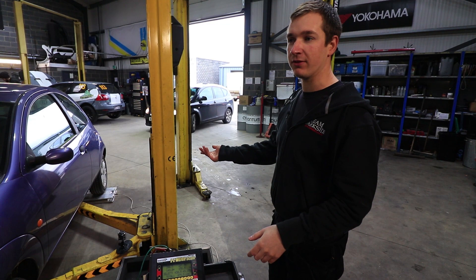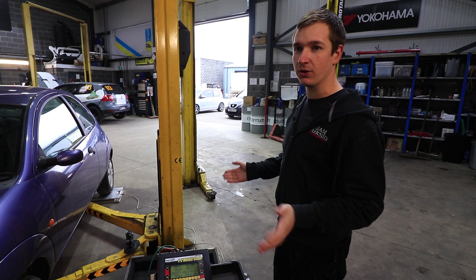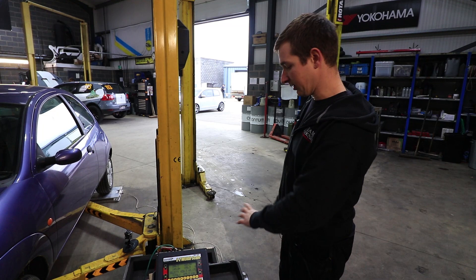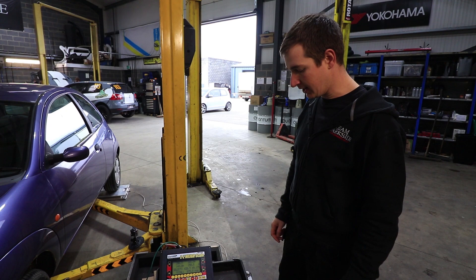That means I'm about 80 kg and Scott's about 80 kg. If we get a really light driver we're going to have to ballast up; if we get a really heavy driver we could do with being lighter. We've got some ballast plates from our other cars that we can just throw in if we need to, and they'll go on the passenger side. Looking at it, we're not going to have to do too much work. Let's go over to the bits and have a look.